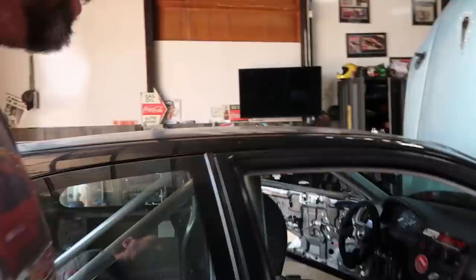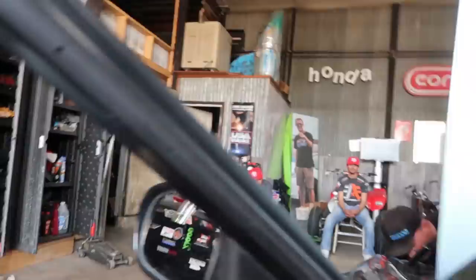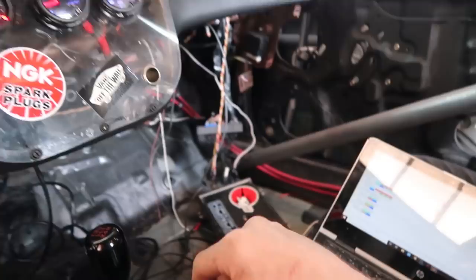Alright, the wiring's all figured out. Turbos keep America fast. We've got to rebuild the tune because we couldn't get into the ECU to see what tune was in it, and it doesn't sound like it was something we wanted anyway since the MAP sensor never worked. We're fresh - we put a new wideband in it as well because the sensor pins were all broken. We went with the AEM X series and put a new board in the ECU so we could connect. That's got us pretty squared up - jumping through all those hoops should get this little hot rod rocking.